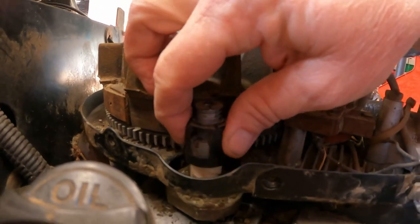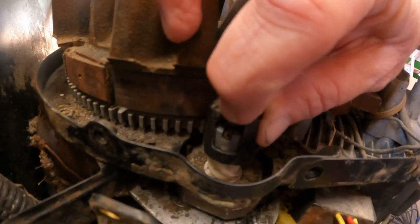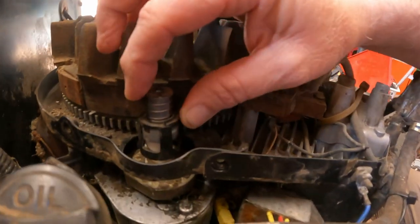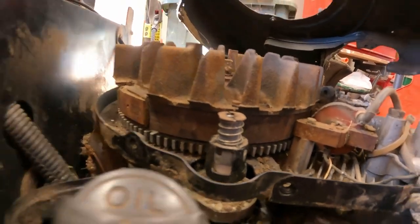The starter is not going to be a joyful thing to get off, so I got looking around the internet. I'm thinking the starter is good, but the teeth just chewed up on the gear. Can you replace the gear? Of course the answer is yes, because I made a trip to the local parts store in Chatham — Chatham Outdoor Power and Pedal, I think it's called. I picked up a new gear for the starter. Eleven bucks, not bad at all. For this particular style, the gear rides on that white plastic, and there's a pin right below my finger. You pop that pin out, this assembly comes off, put your gear on, put this assembly back on, and put the pin back in. Sounds simple enough.